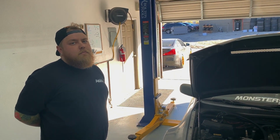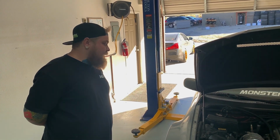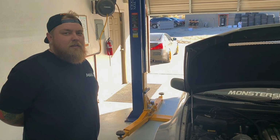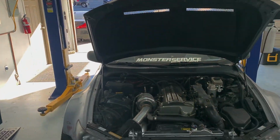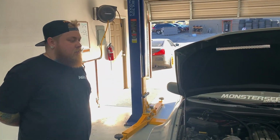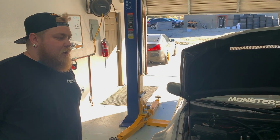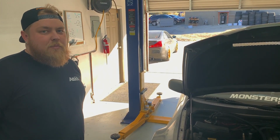So in Europe, it's like not there anymore. Yeah. And when we did have it, it was like very different quality. So the stuff you got on Tuesday from the same gas station was different, and that's like your biggest nightmare when you're flooring a car, top of gear in fourth. That's really not what you want to have. Your content changes. Oh no, yeah. That was pretty bad out here when we first got ethanol. I remember a lot of Evos getting tuned on ethanol, and it was before flex fuel sensors were a real thing, and a bunch of cars blew up because of content change.